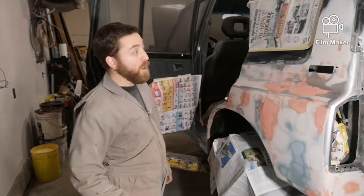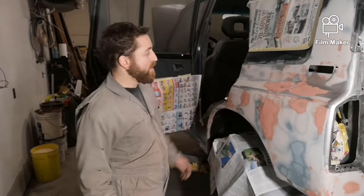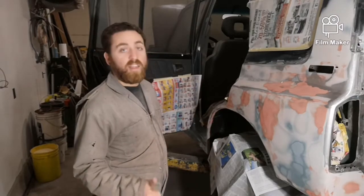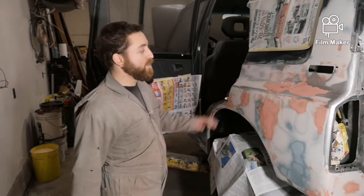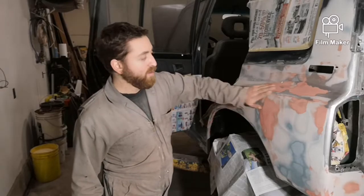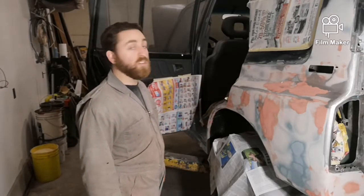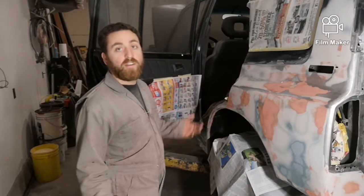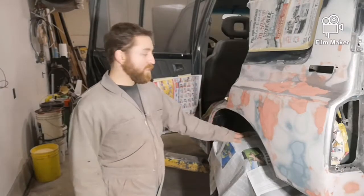But if you are going to paint your whole vehicle after you do the body work, spray a buildup primer on, wet sand it. If you wet sand, that's even better. It's a little bit nicer. And then put your final paint on. But this is just to tie it over to the spring so I can use it for snow plowing. And then I'll do a video in the spring on doing a complete paint job on this. So it's just a temporary deal.